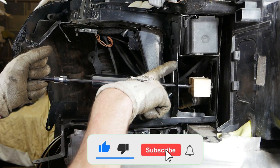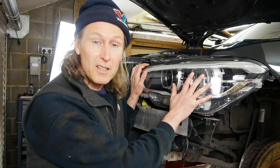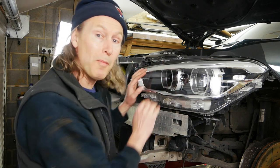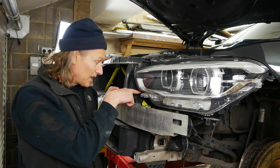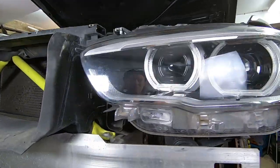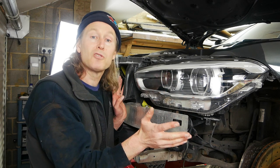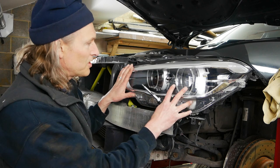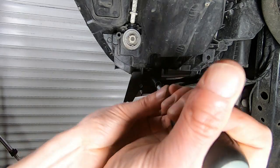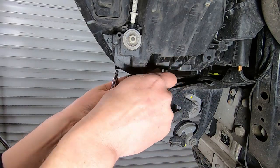It might seem a little bit extreme, but I'm actually going to pop out this passenger side headlight - it only takes a couple of minutes to do. The first reason is it'll give me a really good frame of reference for what might be missing from the other side or be damaged. The other thing is just inside here there's a little air duct which looks like it feeds fresh air to the air box, and I can see it's loose and wiggling around and not seated properly. I just want to make sure everything in this area is correct. There are just a few extra screws to take off - some are back under the wheel arch. The first one at the back under the wheel arch is a little bit loose, which suggests this might have been removed in the past as well.